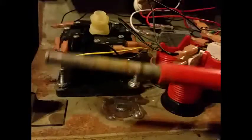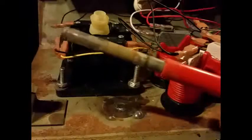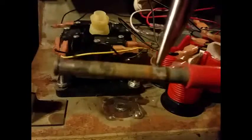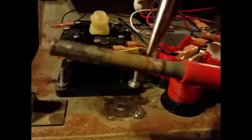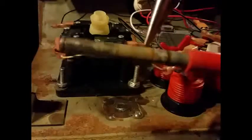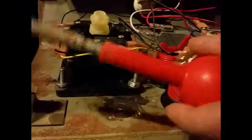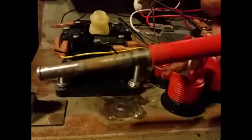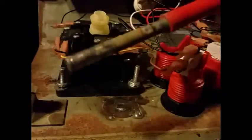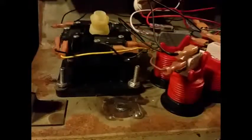There's the clip — got that clip out. That should just pull out nice and easy. Now, if yours doesn't pull out easy, the rubber sometimes gets corroded to the metal and it's practically welded together. Sometimes you gotta use some penetrating oil, or sometimes you just gotta kind of play it by ear. This one came out pretty easy.